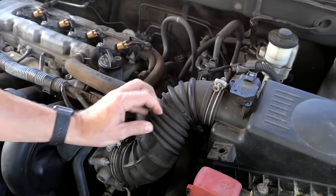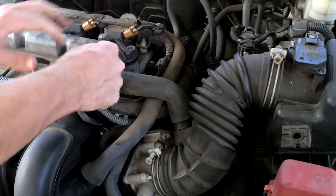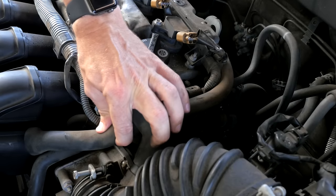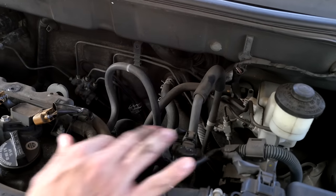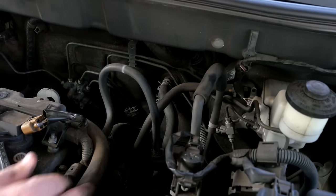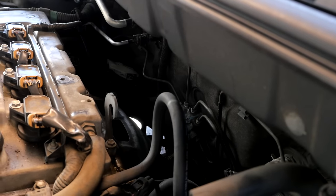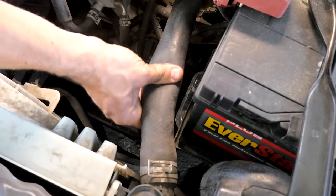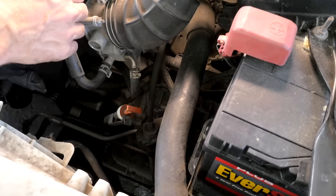This is a big problem area. Oftentimes you'll get cracks around these flex joints. Any air hoses going into your manifold — you're checking the joints where they connect, and you're looking for collapsed hoses, cracks, and splits. Your evap system is usually back here by the intake and can cause shaking and vibrating if you get a hole in there. Depending on your engine, you may have a lot of vacuum lines that run behind your intake, so remember to check stuff behind the engine. There's obviously going to be a lot of things that aren't vacuum or air lines, like coolant hoses, but if you don't know the differences, just double-check everything.